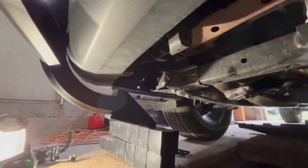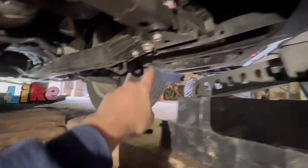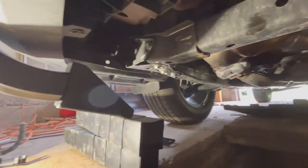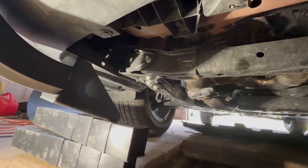See, I got it suspended, basically somewhat in place where I would like it. And these, I was trying to see about getting them bolted up here, because you can see where the motor mounts are, because these other brackets are just too far back. There's no way it's gonna reach that one or back to that one. So now we're looking at trying to come across onto the cross member, which means I'm gonna have to cut the dust shield, which I have laying here, but I'm willing to do that.